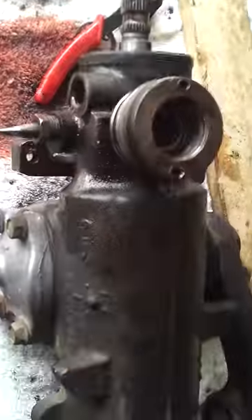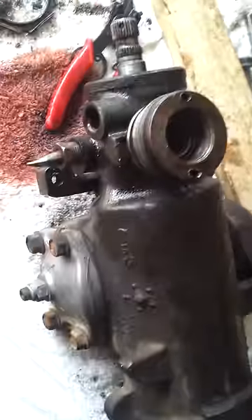These YouTube videos show very minor things problematic to this Saginaw steering gear. That's the steering gear pitman arm, pitman arm seals inside there — mine wasn't leaking so I didn't bother with it. For the adjustment, if you've got slop in your steering wheel, check your tie rod ends first.